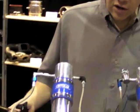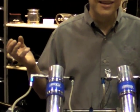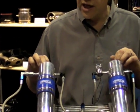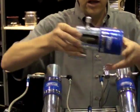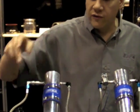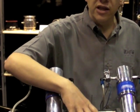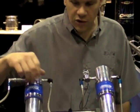What we use is the characteristics of liquid CO2 to cool the air intake charge, which gives a denser air charge to give you more horsepower. We all know how much quicker the car feels with those cool conditions. What we're doing is giving you that at the flick of a button. We have the air intake components inside of the air intake system that freeze up with the CO2 flowing through them and then eventually exhaust out onto the intercooler. When you freeze up the intercooler like that, you definitely have higher intercooler efficiency which nets more horsepower.